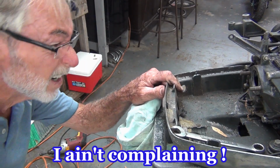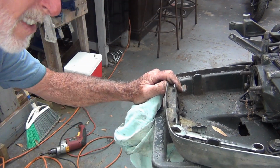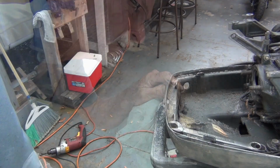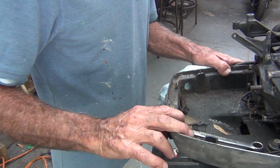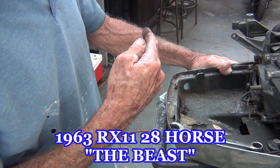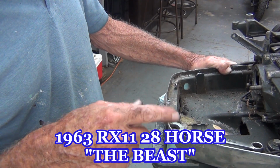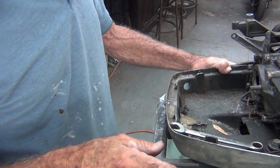Check these reed valves out. Everything looks fine. Happy boy. Can't believe the kill switch. Totally dead. But they're easy to do, like on the one I stole out of the beast over here. Tear the rubber off, get in there with a wire brush, clean the contacts, boom, good as new.